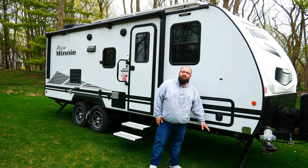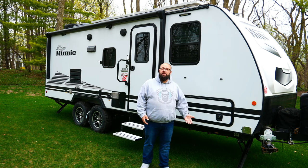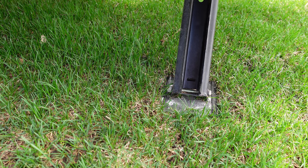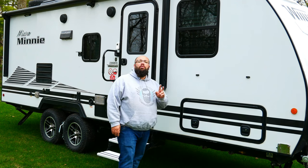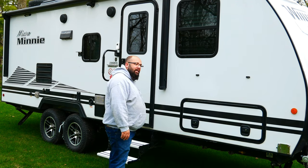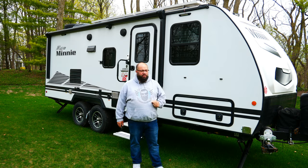Looking down at the stabilizer feet, I bought an attachment that connects to your stabilizer legs to help spread the weight of the stabilizer. So if you are in soft ground like this dirt here, it doesn't sink in the mud and creates a nice stable platform — that way you don't have to carry those plastic pads around. I've also added two more fresh water tanks: a 40-gallon tank and another 40-gallon tank. There's also the stock 36-gallon tank right behind me. I'm going to make detailed videos on those later, so be sure you subscribe.